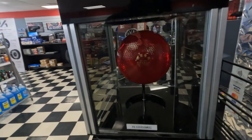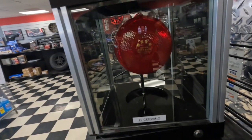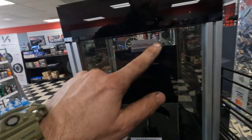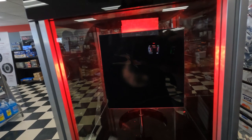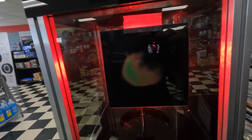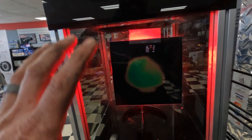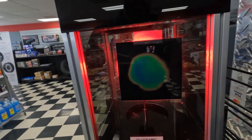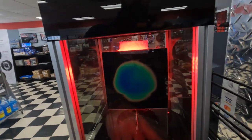We're going to roll this around. As you can tell, it's gotten lighter. But the thing is, this has 70% ceramic, and what that ceramic is, is basically these little tiny ceramic particles in there, and what it does is it helps reject heat. They use ceramics like that actually on the space shuttle, so on and so forth — it's a really cool technology they've been coming out with recently. See how much slower that is going — it's not even turning blue yet; by now this thing would already be blue. And this is the old carbon ceramic, which is basically our base level ceramic tint that we use here. We do have a nano ceramic film that they applied to my Jeep and I'm excited to get it tested out. It really shows you guys the value of the ceramic tint as opposed to your regular dyed film.